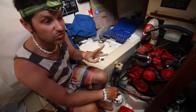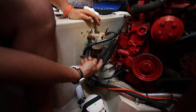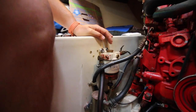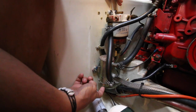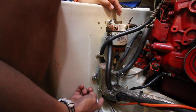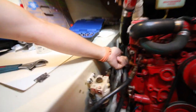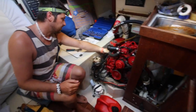We've got three fuel filters. We've got our primary fuel filter which also separates water if you get any water in the fuel, then we've got a filter inside the first stage fuel lift pump, and then we've got a third filter right here just before the engine-mounted high pressure pump. Can't really see that one in the shadows there, but it's there.